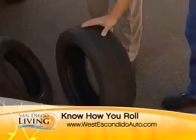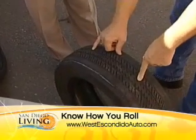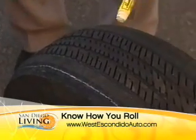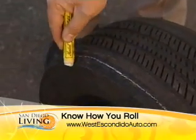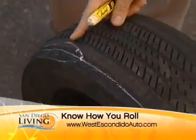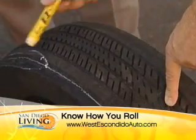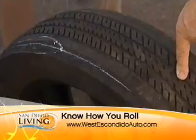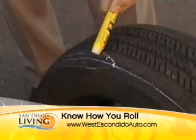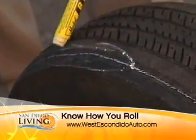You can see this tire here has plenty of tread in the center. These are actually wear bar indicators that the tire manufacturers build in — so when it gets close to the wear bar indicator, you know it's time to replace the tire. But if you look at the inside of this tire, you can see where the steel cord is showing. The outside is also worn out. Most consumers won't see this, but when you come into a facility like ours, we're always looking at the tires for you.